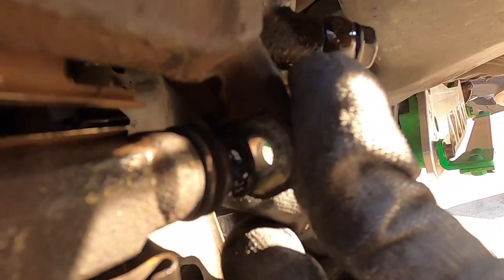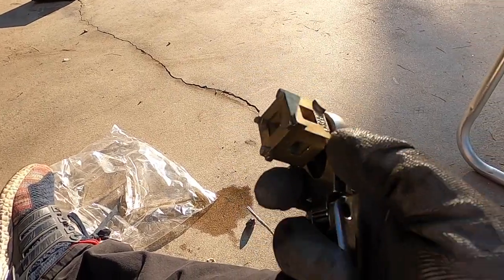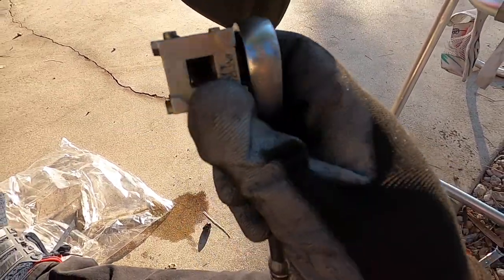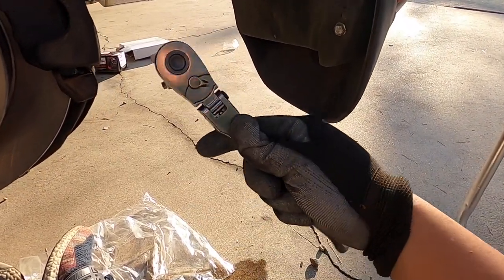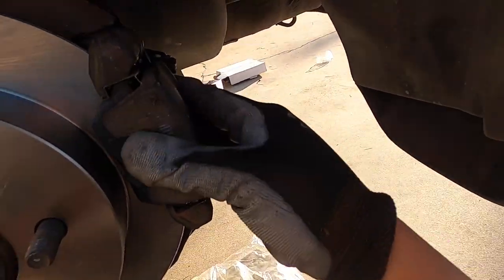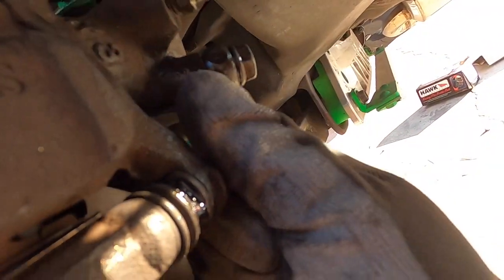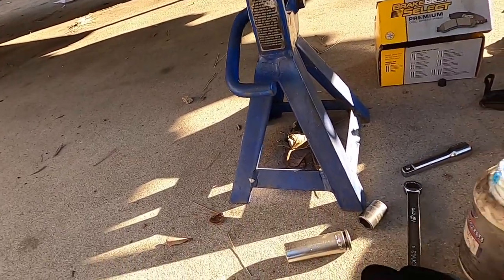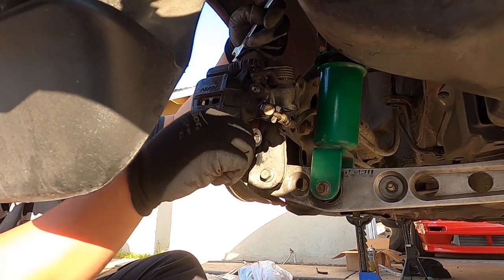Close the bleeder hand tight. Fit the brake pads in — behind the brake pads in the back, and bring it over at the front. Make sure you get the slots right and how it sits flush, just like in the front, so it lines up with the caliper. Then the 12mm bolts will go in. The brake tool I mentioned goes on a ratchet and has slots for the piston holes — but needle nose is faster since the angle is easier.